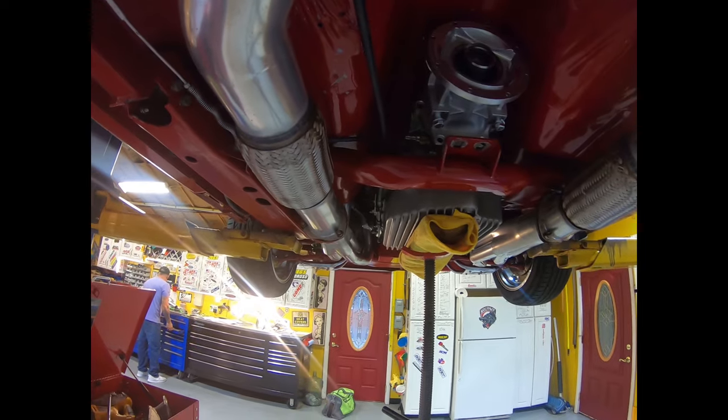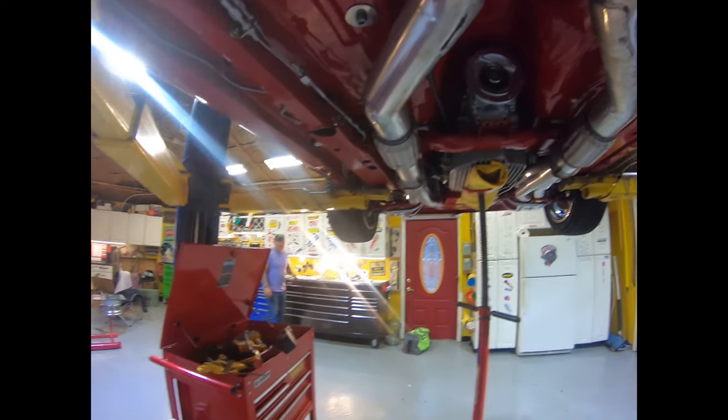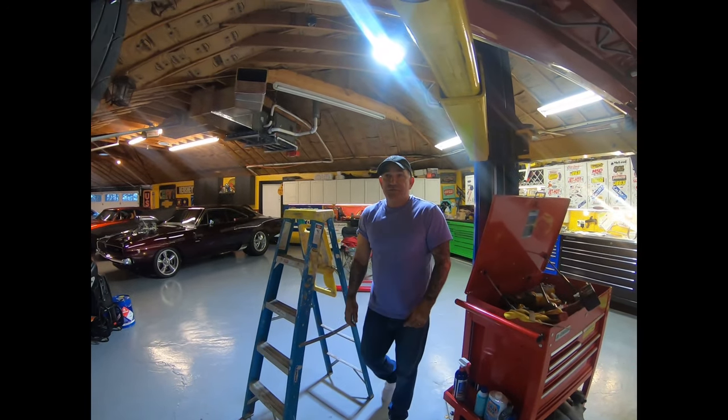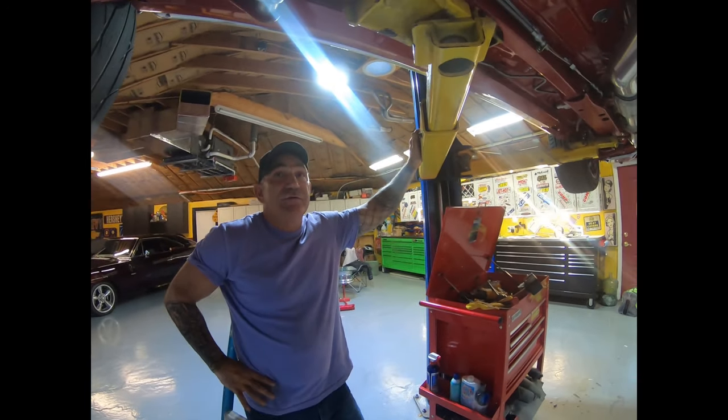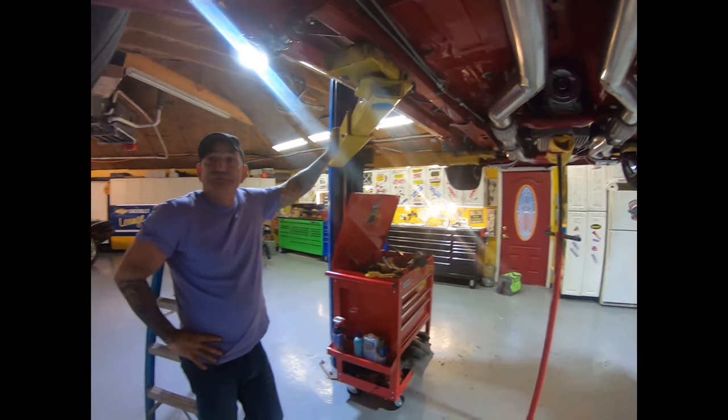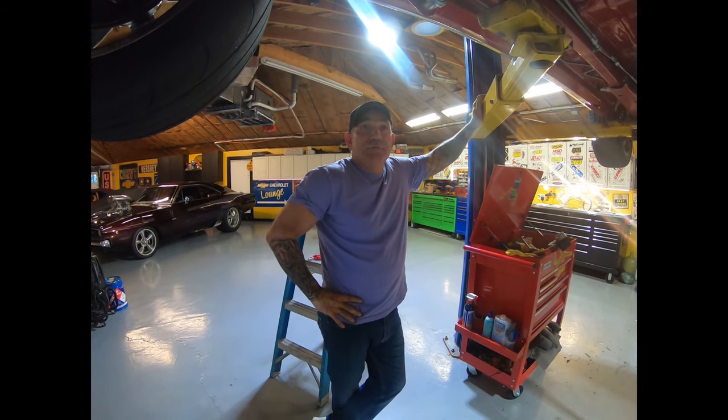But essentially, this is going to give us the ability to split the gears in half, is the idea. So you'll go first, second. Second over will be like having 410s, so you won't pull away like you did. You'll be able to reel him in. Well, you'll be able to keep him from reeling you in is the idea, because you had him in the...